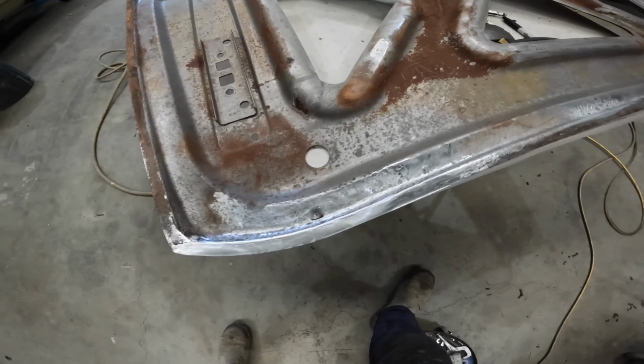From here we're just cleaning up all the inside of the frame. You can either have it blasted or acid dipped. Probably quicker way, but this is where we had the boot lid blasted before we stripped it, so cleaning it up manually. Just see the rust in the corners of the boot frame, pretty common. So from there we repair up those rusty corners,